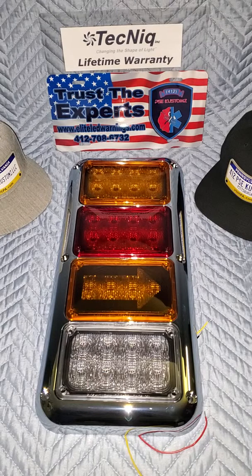Down below that is your stop and tail — brake light. All the DOT lights come with a three wire: you have your positive, your ground, and then you have a yellow. That yellow is basically a dim feature — your tail light or parking light feature. You would wire that to your parking light wire, so when you turn on your headlights it lights that light in a dim mode. When you press on the brake or turn on the turn signal, that energizes your positive 12-volt red wire, which increases that brightness — giving you that DOT dual function.